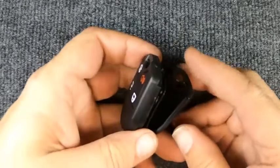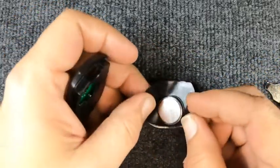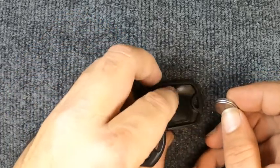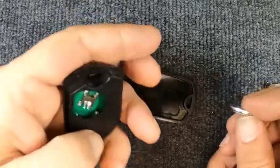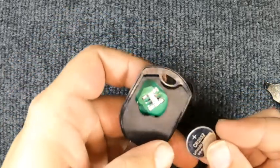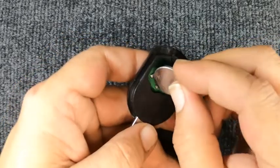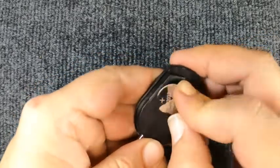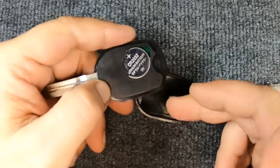The two halves open up. The back cover and little rubber gasket popped out and brought the battery out with it. You might get lucky and it might come out that way — if not, don't sweat it. This is your CR2032 battery. When you put it in, you'll push inwards and down.